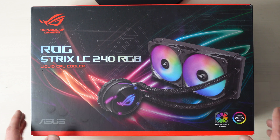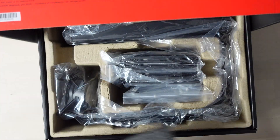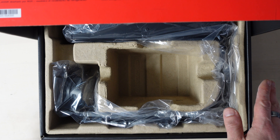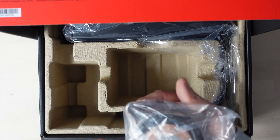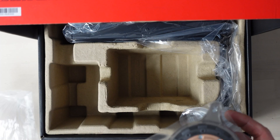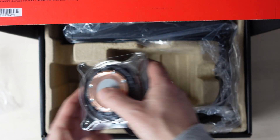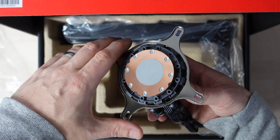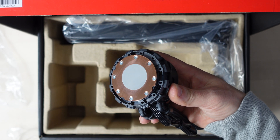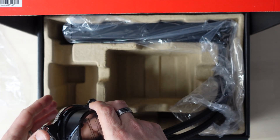We need to get this guy ready to go into the computer. You've seen me unbox it so I won't go into too much detail — if you haven't, it's in another video and I'll pop a link in the corner. Because we're using a Ryzen processor with the AM4 layout, that's what we need to set this up for, and I think it's already set up for Intel so we need to fix that. We need to change this mounting plate — I'll turn it clockwise to take off the Intel mounting plate and then put this on anti-clockwise. There we go.